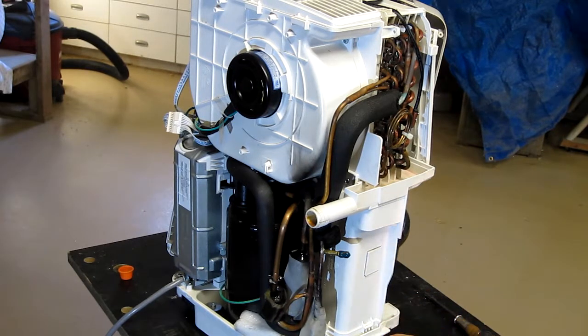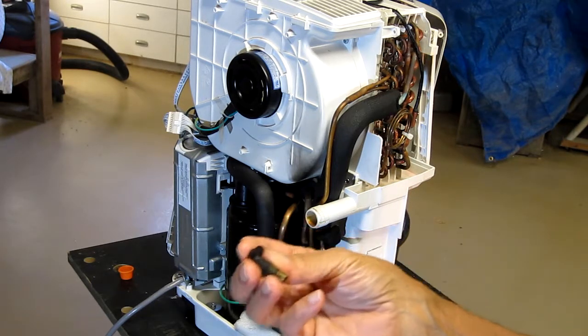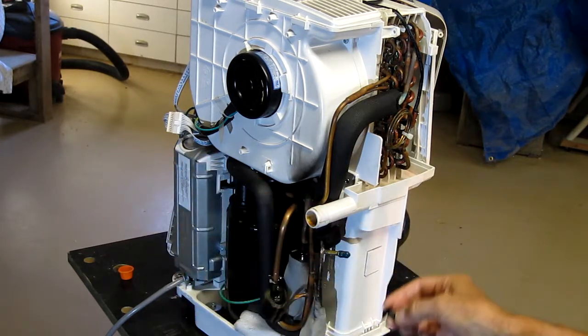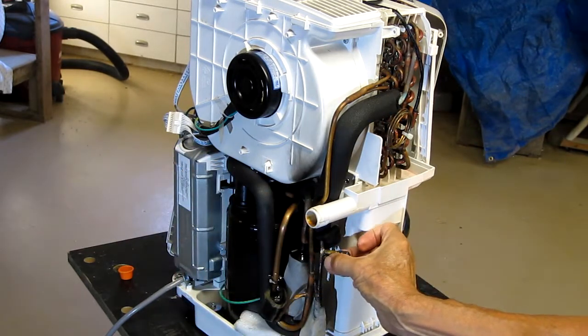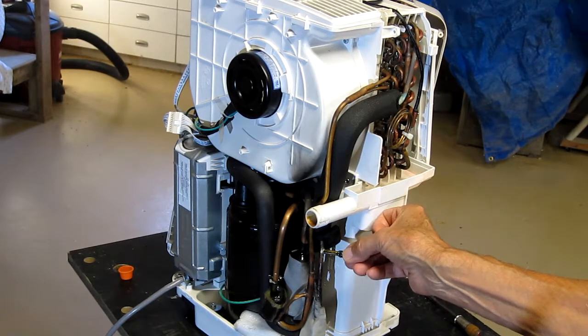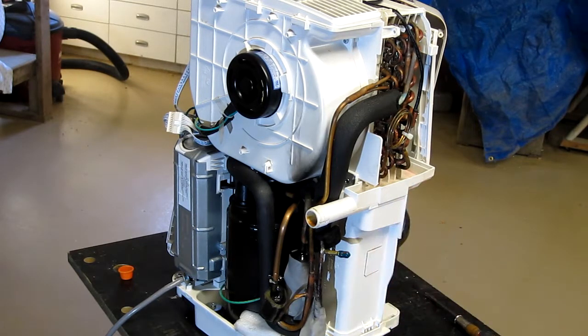There's no access to the system because there's a charging tube that's been crimped off and soldered — no valves. So I've got to add something. What I did was take a valve from an old tire, an old inner tube, stripped the rubber off, and brazed it onto the suction line. Then I ran a sixteenth-inch drill bit through the old valve core and pierced the suction line.